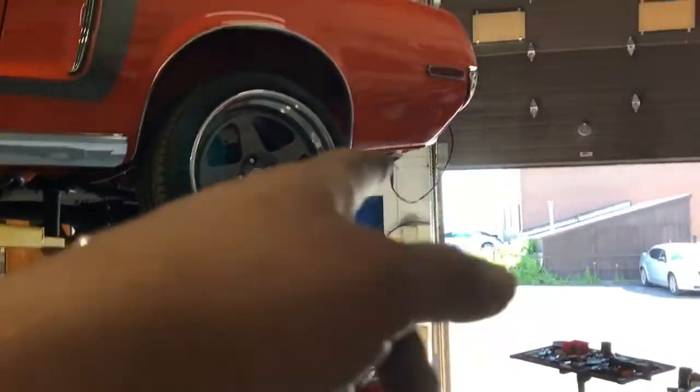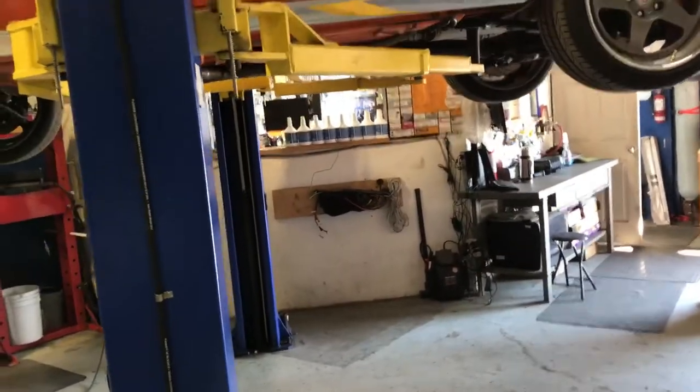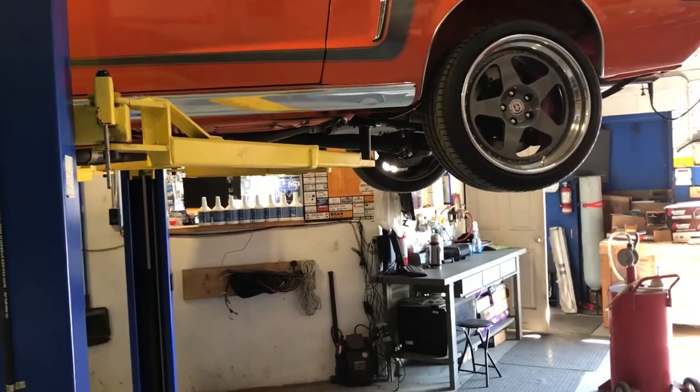So I've got the wideband O2 in the back of it to make sure that the FAST EFI is giving the right AFR and it's reading right and that the actual sensor was still good. So I had it there. I fixed everything fine. I got it to idle. I got it through its 14.6, 14.7.